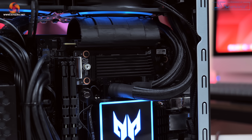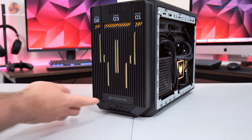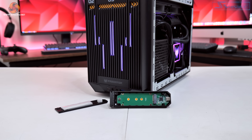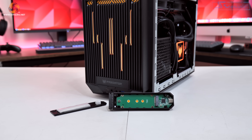There are two internal M.2 slots, but both are occupied by 1TB Micron PCIe Gen 3 SSDs — just 2TB total in a system costing over £3,000, which feels very stingy. These are also Gen 3 drives when Gen 5 SSDs have been on the market for several months, which I'd expect at this price. There is a removable hot-swap enclosure in the front panel for an additional M.2 SSD, though it comes empty by default.